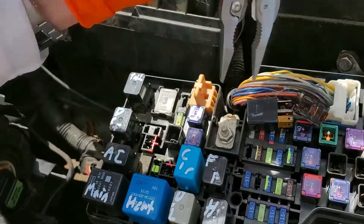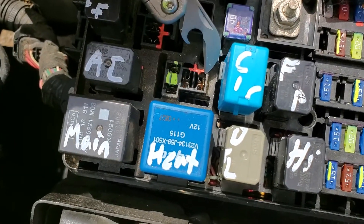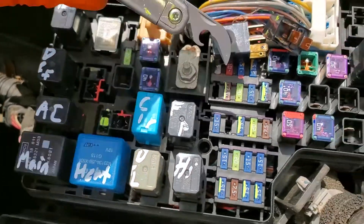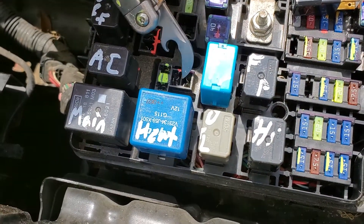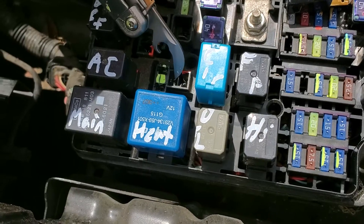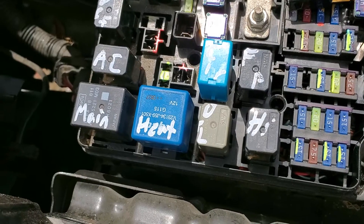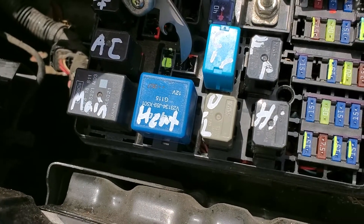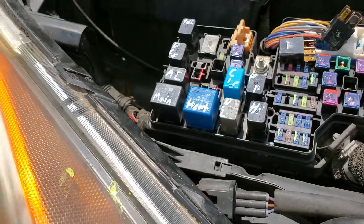For further troubleshooting, one thing you might do is take a wire and connect these two pins together. You will be sending power directly to the starter from your 40 amp J-case fuse. If you connect these two pins together the engine will turn over, assuming that the starter is in good condition, the battery is good, the wiring is good, and the engine is not seized. Do not do that if anyone's hands are in the engine compartment or if the car is not in park.